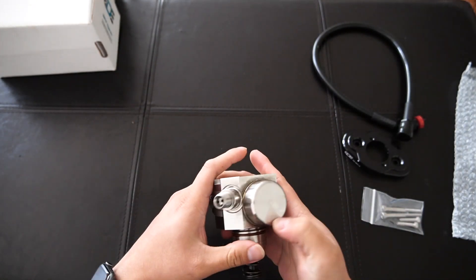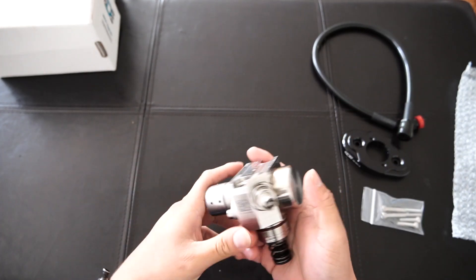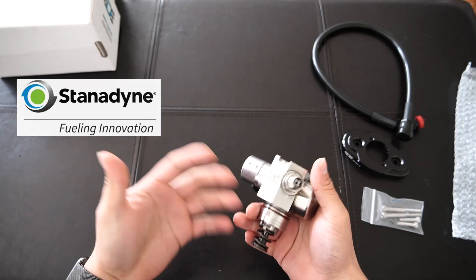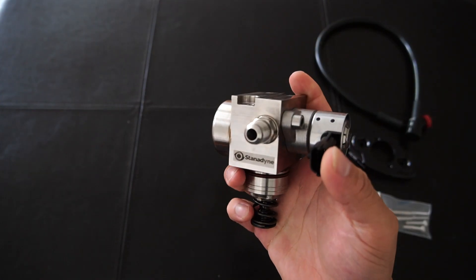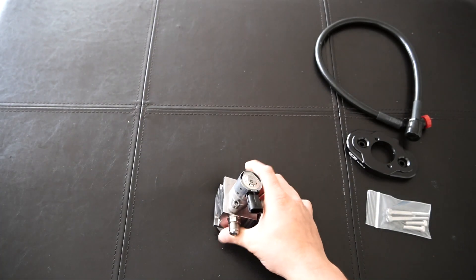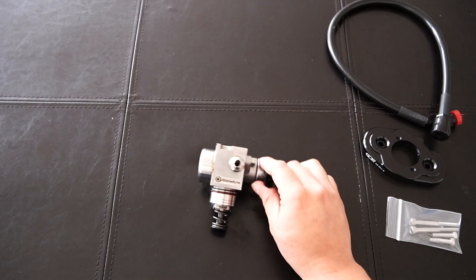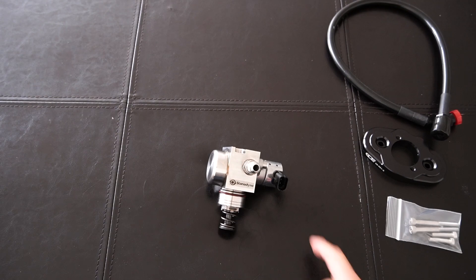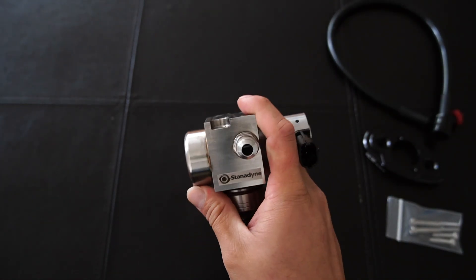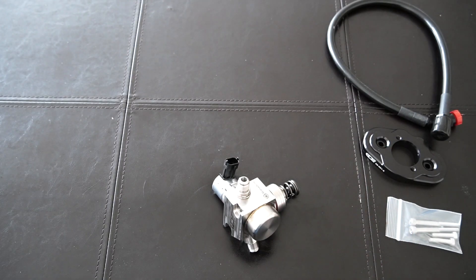This pump overall is different internally. Some people don't realize this but it is laser welded. There have been some rumors out there of people saying these are just any other GM pump, and that's simply not true. The pumps are actually made by Stanadyne, which is the pump maker that makes all the pumps for GM, Dorch, and a few other companies. So it's not that Dorch Engineering copies GM — they're all made by Stanadyne. Any LT4 pump, GM LT4, any of the other companies making these types of pumps, they're all getting their pumps from Stanadyne. But Stanadyne doesn't actually sell anything directly; you have to partner with them and do the engineering side of it. So regardless of whether the chassis or internals are made by the same manufacturer, the engineering still has to be done by the company requesting the pumps — that's why you have the variances between each company in flow.